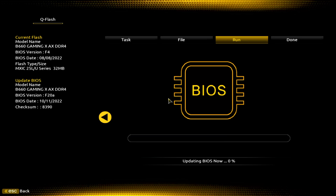I'm going to leave this running because I like to make these videos as long as the actual event takes — that way you know when you're doing this, following along, how long it's going to take from start to finish. No editing. When we're looking in here, you can see the current BIOS and what the updated BIOS is — that F20A. You can also see the model name matches up. If they did not match up, that'd be a problem.